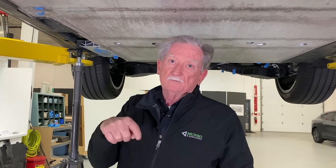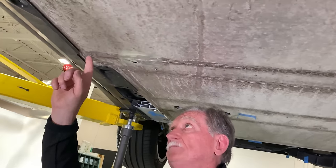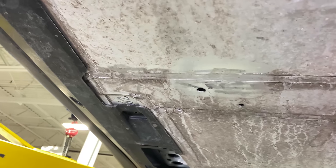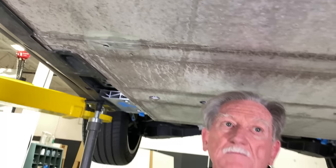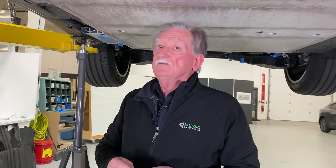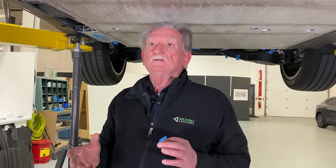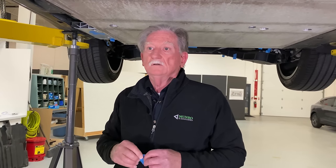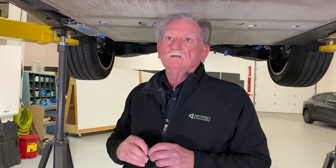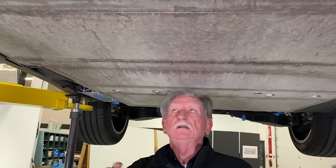In essence, it's a spindle. It moves very, very quickly, and it goes in that little hole right there. It pokes its way in, and then it starts moving across, and as it's spinning, it turns the material into a plastic state, not like plastic dishes or something like that. Plastic as in the metallurgical term, which means that it enters a semi-solid state. When it's in that state, it doesn't have any induced tensions and stresses.